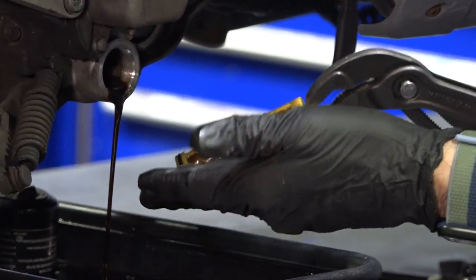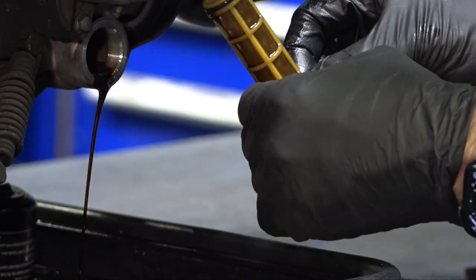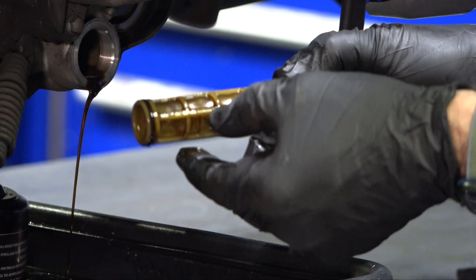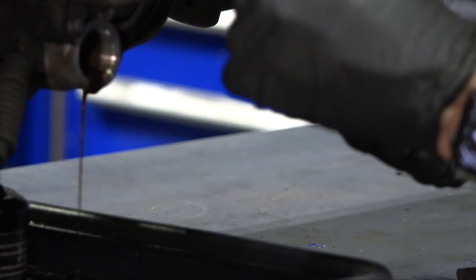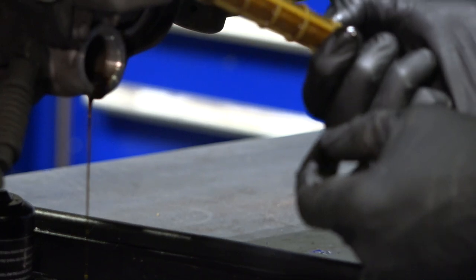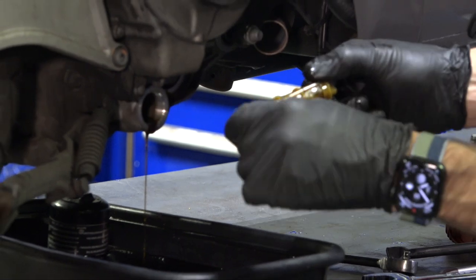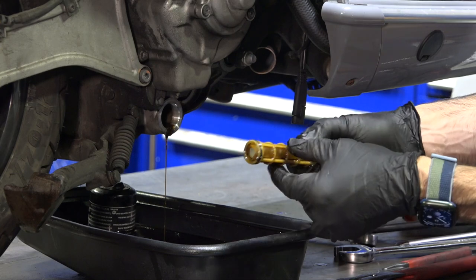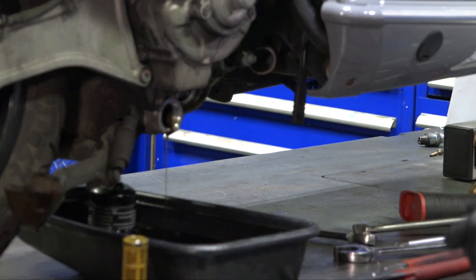Look at the strainer — typically you don't need to clean these out, but if it looks clean with just a small bit of gasket debris, just wipe it off. You could spray it with solvent. If there are a couple of small metal fragments, don't be alarmed, but if there are a lot of metal fragments and the motor knocks, then be alarmed — that could indicate precursors to a rod knock or cam failure. It's always a good idea to look at your strainer.